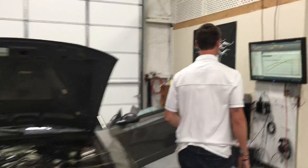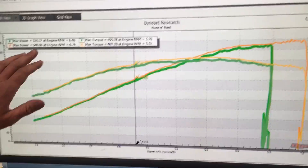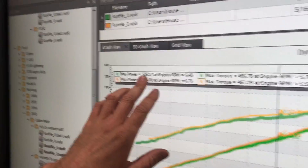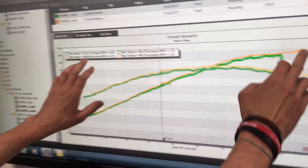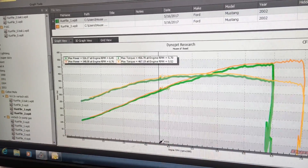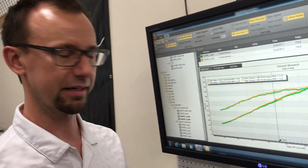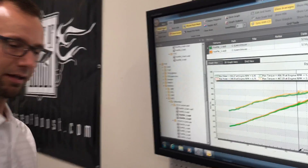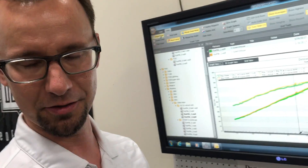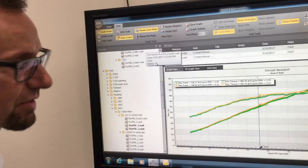Here's the deal: not too bad on the surface. This car's on 12 pounds — it's a two-valve car, 526 horsepower when revved to 6500, 548 at 7000. When I was dynoing this I noticed the car felt really lazy on power for what it should be doing, especially for the blower speed. So I decided to measure boost before the intercooler and after the intercooler, which nobody does.